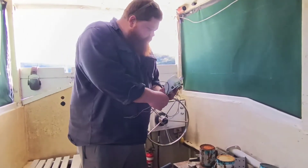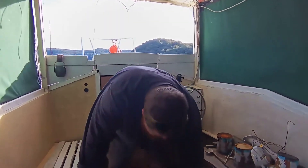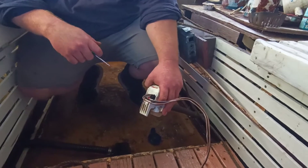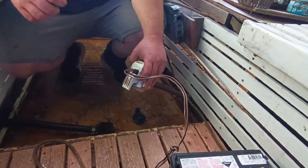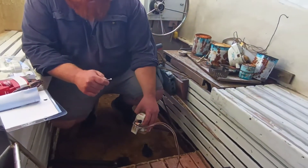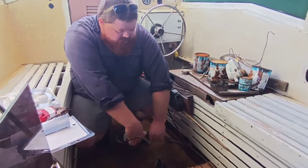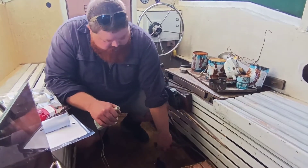That one's not going to be working at all. The old one being replaced has got an automatic sensor in it - moving parts - that will sense when water comes up. This new one doesn't. With the new one for the sensor, you can also connect them individually, so you connect the pump and an independent float switch in series. Anyway, we'll go ahead and take this one off. That's come off.